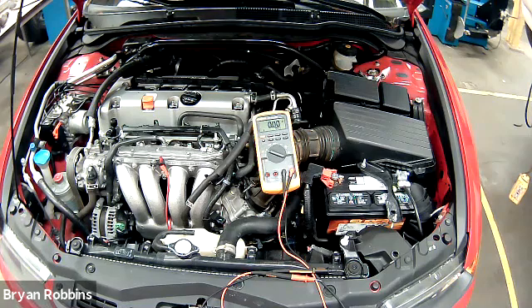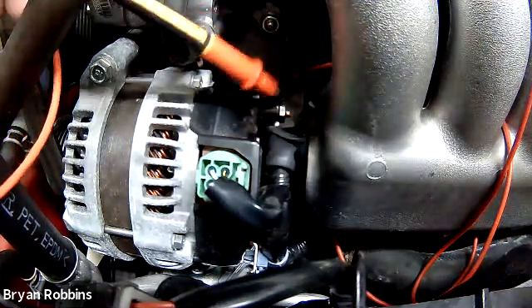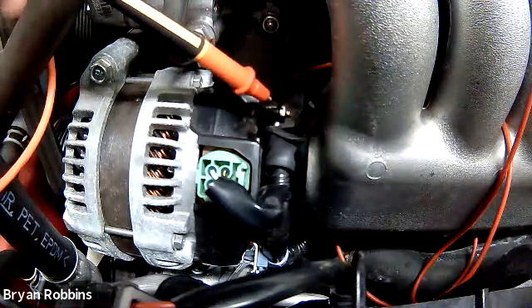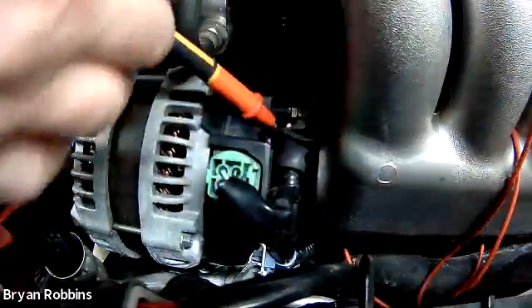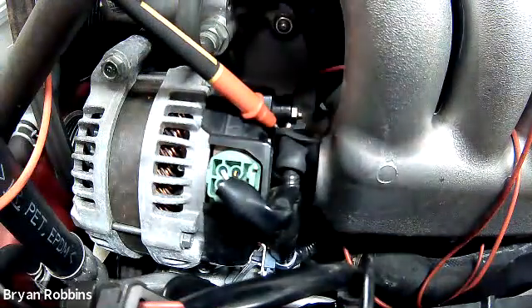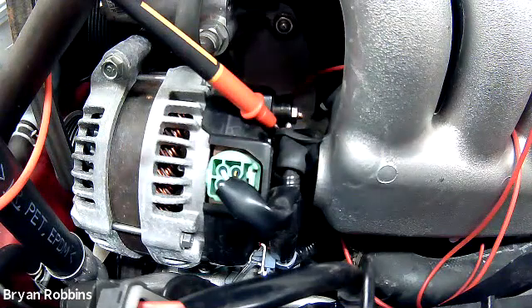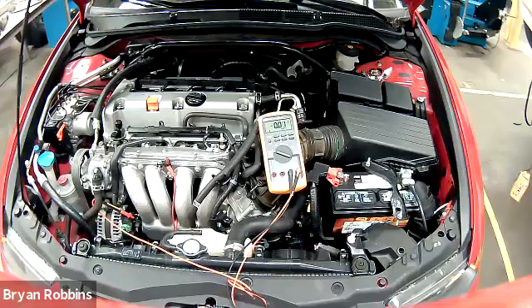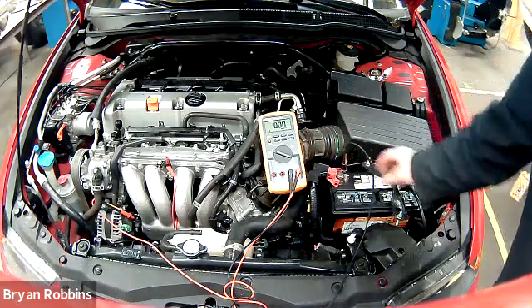So today we'll take a look at testing. We're just going to test the positive side voltage drop on the charging circuit. Here's our alternator and the main battery connection to the alternator is this terminal right here. Just like on the starter motor, you're looking for that big wire that's bolted onto the alternator. I'm going to take and wedge this probe in, make a good solid connection with the end of that wire. And then we can hook up the wire over onto the positive post on the battery. With our red wire over on the main terminal on the alternator, we're going to take the black wire and put it into the battery positive terminal, to test the voltage drop on that circuit.